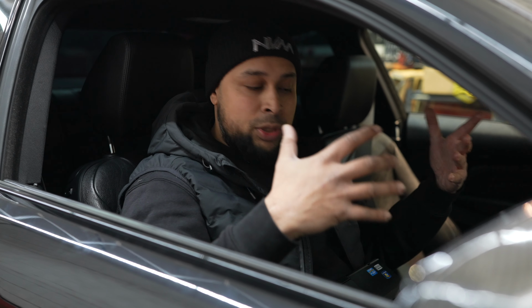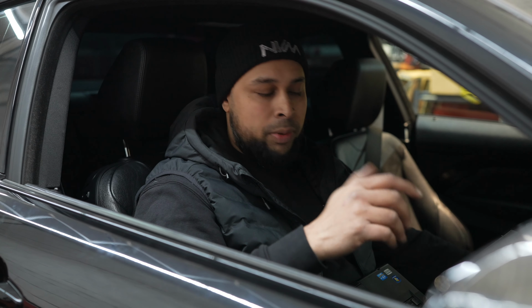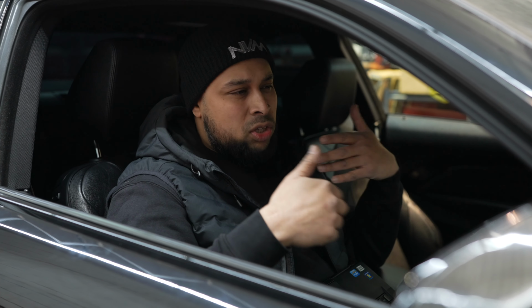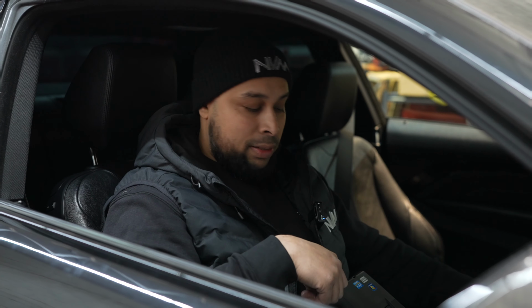So literally on our previous boost settings, and we did put a torque cap and a boost cap in there on the stock turbocharger so it didn't go over, it's made exactly the same power and torque: 340 brake horsepower, 654 Newton meters of torque, which is nice and healthy to see. There is obviously a bit of lag, so there's a bit of a deviation lower down, but we can account for that when we start turning the boost up. So we can increase the boost incrementally and see how it responds. It's got a bit of a lazy lambda sensor on there, so it'll be interesting to see how it monitors the fuel and see what we can achieve today.